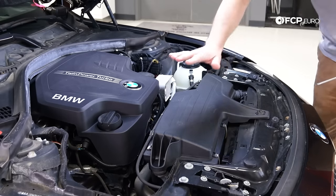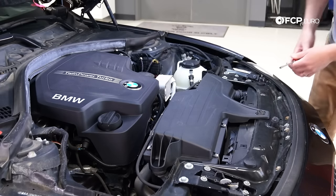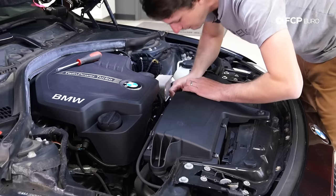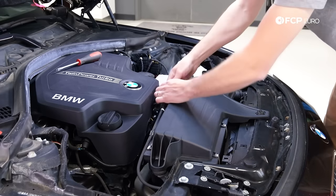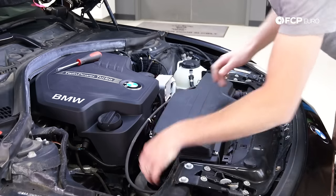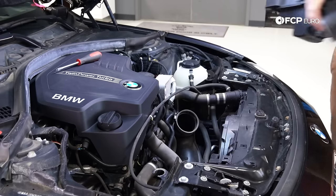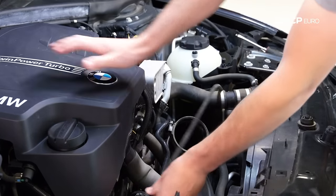The first step is we're going to remove the airbox, the engine cover, and the cowl. This gives us access to the entire top side so we can service this thing. Loosening up the boot strap for the airbox so I can pull it out with the mass airflow sensor attached. Now we're going to unplug that, set the plug aside, and the airbox will unclip — release the hood cable and work these little poppers up. There are three of them. Once that is released, pull down on the boot and separate the airbox.